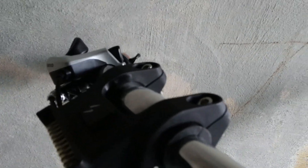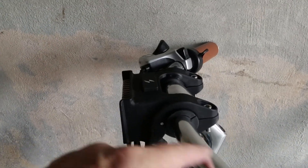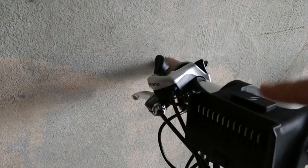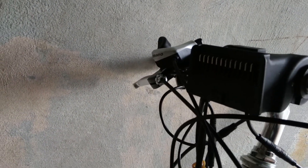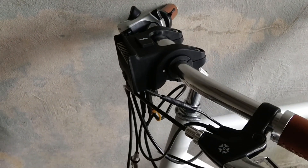The battery lifts off. You have to put this mounting piece on, but no matter how hard I crank it up I haven't succeeded in getting it completely tight. One thing I don't know is where you mount a light, because this one faces backwards — if you get it too close to the battery pack, the battery pack blocks it. The battery pack slots on and off pretty easily; when it goes down, the bottom just hits the front of the bike. You plug all the connectors in — one for each brake, one for the throttle, and one going back to the battery. In the version where you put the wheel on the front, there's a pedal sensor you put somewhere near the pedals, and the pedal assist works really really well.